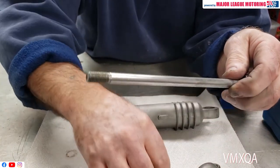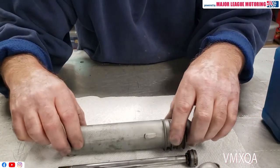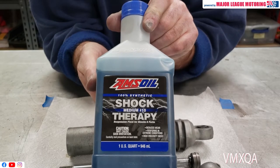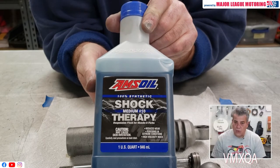As you can see, it's very simple to take apart. At that point you can get your shafts re-hard chromed, you can re-finish the bottom, and when it's all done, I would recommend you use Amsoil shock therapy oil in your suspension. It's really that simple — it's not that complicated to take apart an Elsinore shock. Not like a Works Performance shock or some of your other more modern shocks where there's nitrogen, shim stacks, and other things involved. So that's how you take apart a CR-125 or 250 shock from 1974, '75, '76 too, I think.